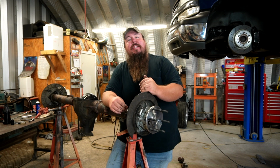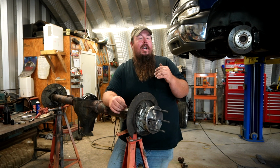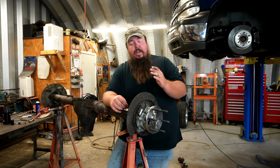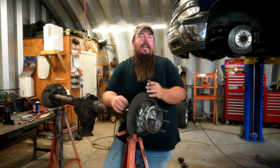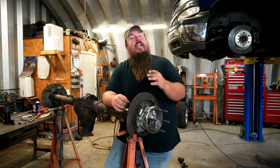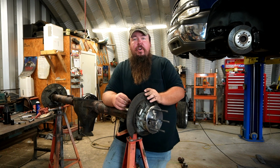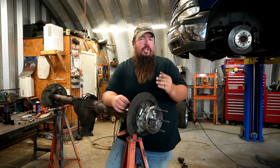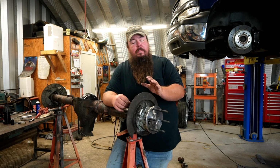But I just wanted to make this video to show off these really nice C-clip eliminators. The guys at Got Torque, they got a really cool design. And I love the fact that they used the taper roller bearings instead of the roller bearing design of the older C-clip eliminators. Those were great for drag racing and for lightweight cars and stuff like that. But for something like this truck at 4,500 pounds and wanting to drive on the highway for extended periods of time, having the taper roller bearings and good quality seals are really going to make a much nicer product.